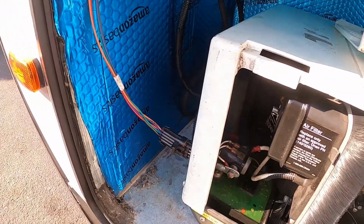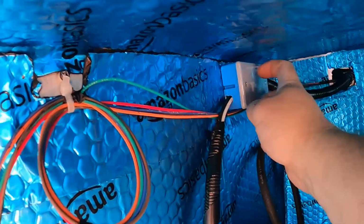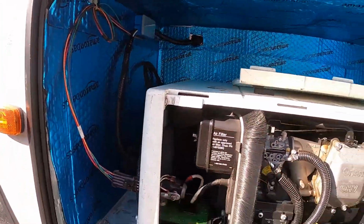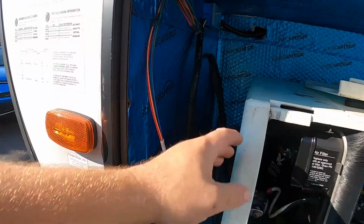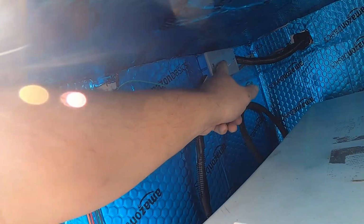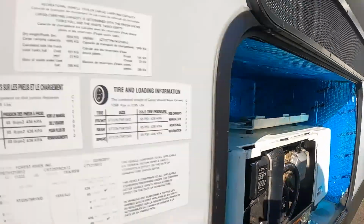Now for the 110 volt power, the output of the generator, it comes up through these wires that were pre-attached to the Onan, and I put a junction box in here. The reason I did that is the transfer switch wires are on the other side of this compartment, which I'll show you in 1 second. So if I need to remove this unit for servicing from this compartment, I wanted all my connections to be right here. I can disconnect my low voltage lines, my control wires, and my high voltage right here at this little junction box, which is accessible. It's out, it's not hidden, you can't have those hidden. So that's all my connections made.